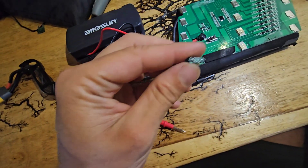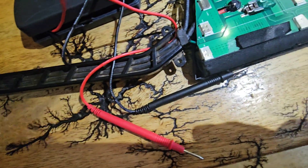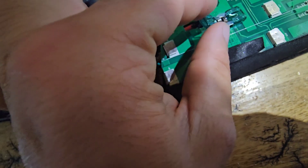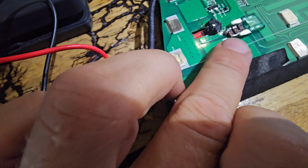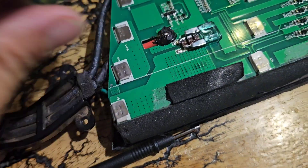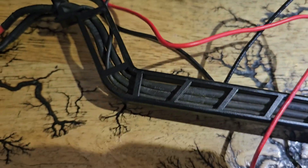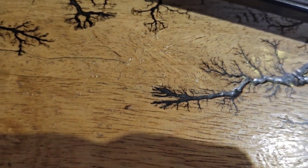I've got the little car fuses, and you can just lay them flat down right there across the contacts, and the same with the other one. Unless you can get the actual Z fuses — I found they're very hard to unsolder and remove. It's a lot easier doing this, and it's obviously the same rating because you're going 60 amps, which is 3 times 20. So you can just connect it like that.